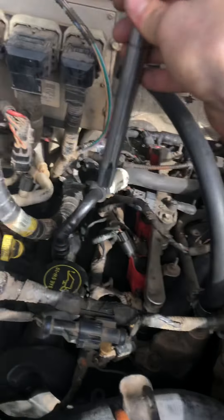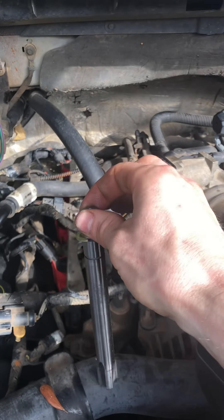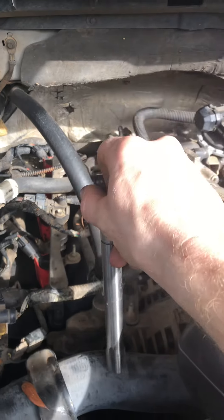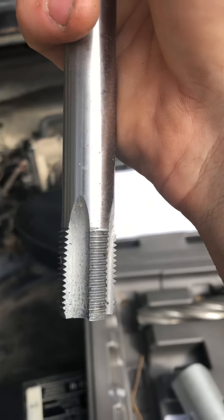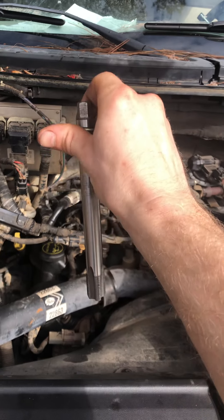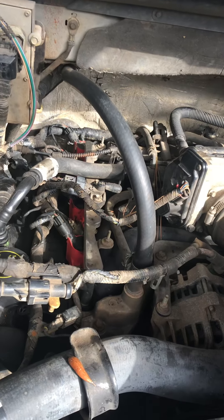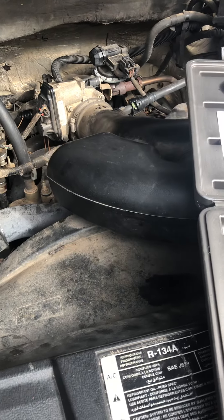It's too big for the guide, but you just stick it down in there and with your ratchet just feel where it starts to bite the hole, then back off and keep going — back off, keep going. I went all the way down and brought it back out, shot it with more oil, and cleaned the shavings off as I went. I kept taking it out and cleaning the shavings so there were fewer in there, but there were still a lot.